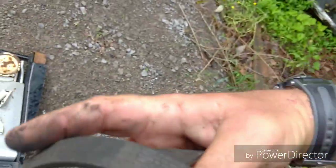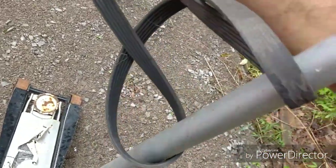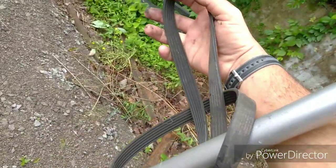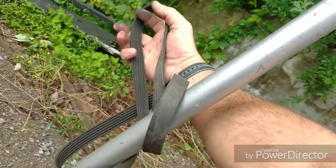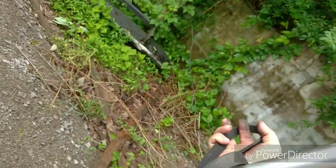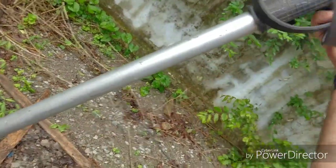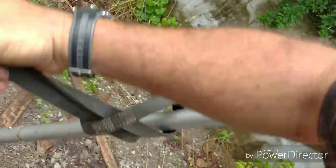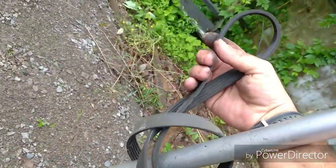You just take the belt like that, and you tuck it around the filter. And if you look, I pull this way, this belt would get tighter if it was on something larger. So you put this belt on there and you stick a bar through it, and you use that to take that filter off. And then to put it on, you take that belt, flip it over, put your bar in there, and you wrap the belt around it until you can lock it down tight.